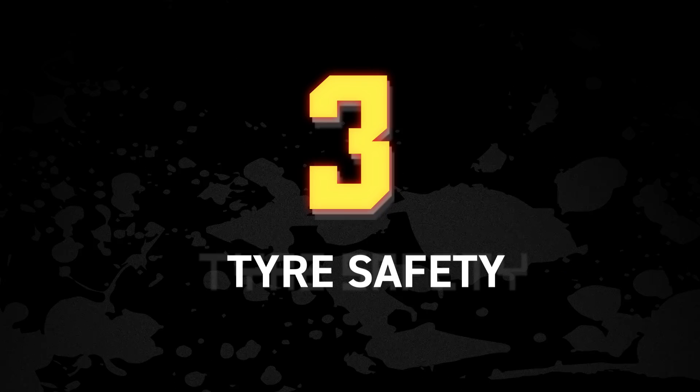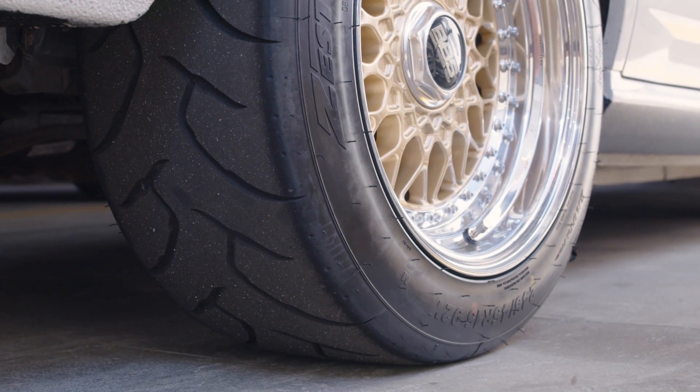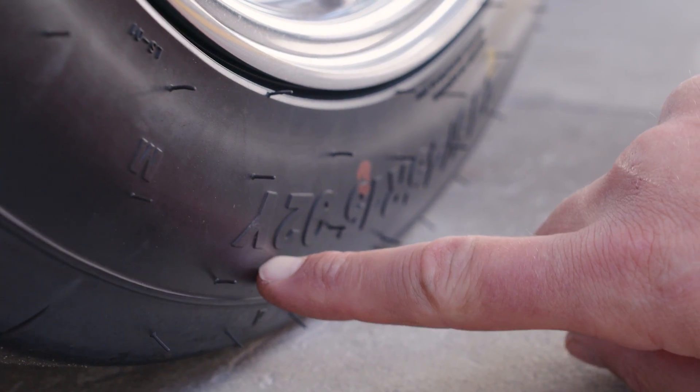Next up, tyre safety. If it's going on a chassis dyno, the drive tyres need to be in good condition and have the right speed rating. The speed rating is the maximum speed the tyre can handle — anything above this could result in the tyre flying apart, which is more typical with bigger four-wheel-drive style tyres. The lowest speed rating is about 140 kilometres an hour, a speed which is almost always exceeded when dyno tuning a car. The tuner might also look for knock-on wheel balancing weights, which at high speed on the dyno or racetrack can fling off and cause serious damage or injury.